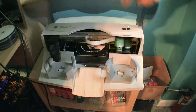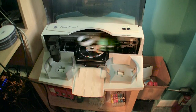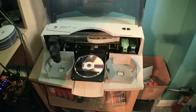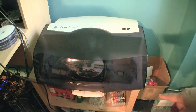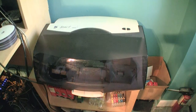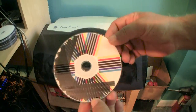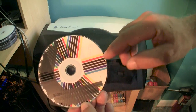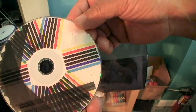Hopefully this will be fine now for this last nozzle check. We have full magenta, full yellow, and full cyan — we are good to go. Similar to Canon printers, we're looking for a clean stripe of color without any lines in them at all.